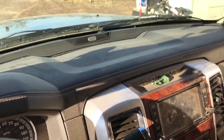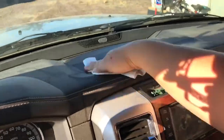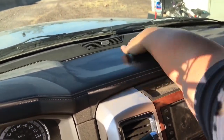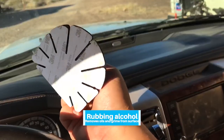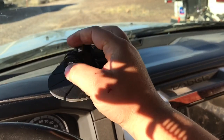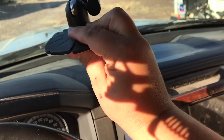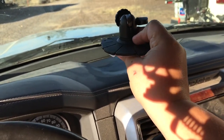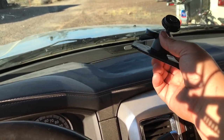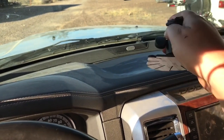As we wait for the sealant to set, I'm going to put in our backup camera monitor in the truck. I'm going to mount it right here and I'm just going to clean it off. Put a little isopropyl alcohol and finish cleaning that off. This is the mount that we'll be using — the bottom is all 3M tape. This hooks into the monitor itself and then these little arms bend. You can mount it and then shape it to the area you want it to stick in, then stick it down and hold it down. Normally when you do stuff like this, you'll want to have it set for about 10 to 20 minutes so that it adheres well to the surface.